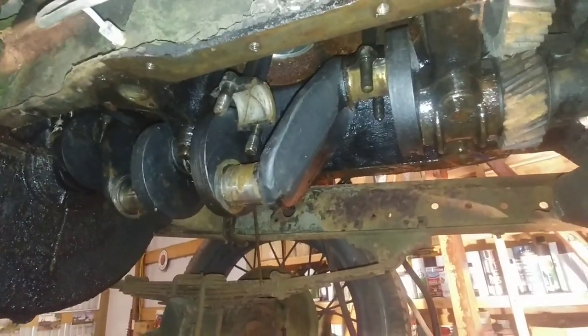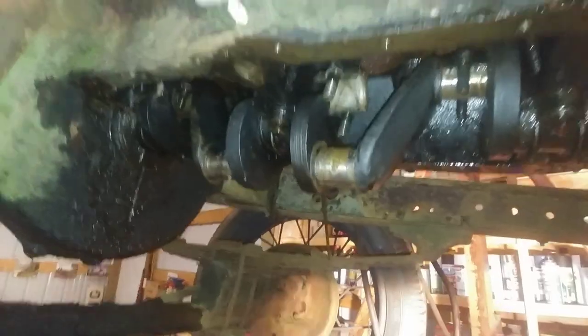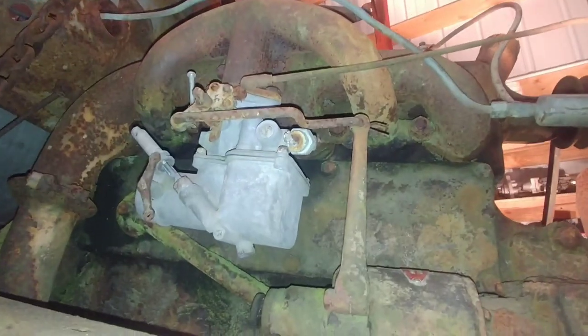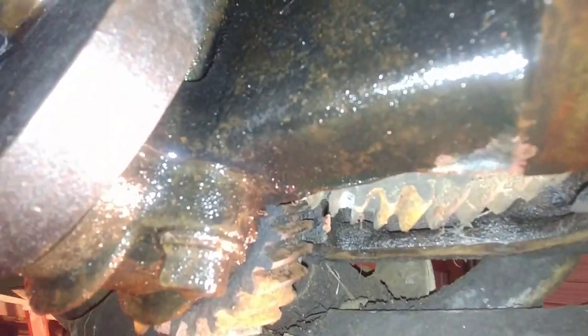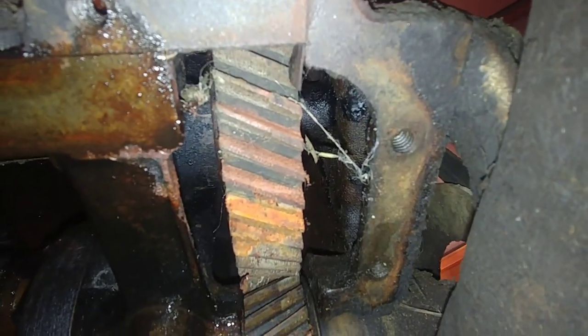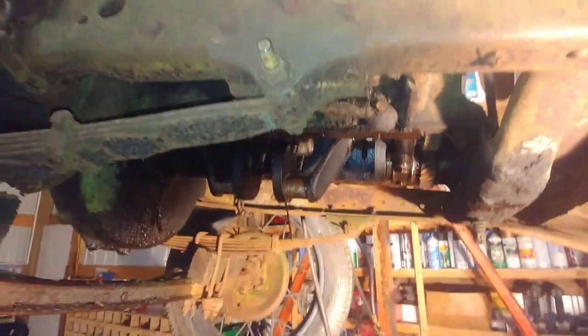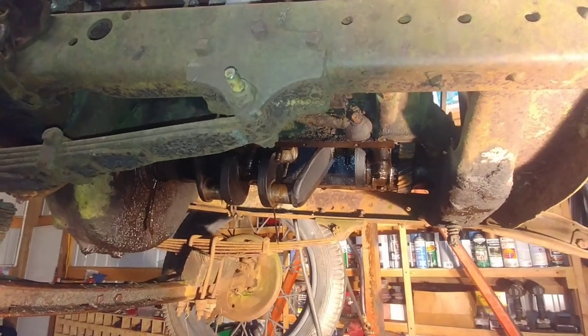If I get it loose and rolling over, I'll clean it and polish the crank and everything. But if the valves are stuck - and they're probably stuck too - I'll probably have to pull that plate and get to the tappets, or lifters, whatever you want to call them. That fiber gear is pretty thin too. You can see how worn it is - thick on the right side and thin on the left.